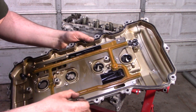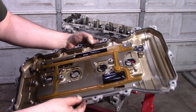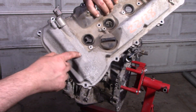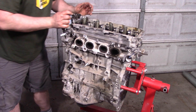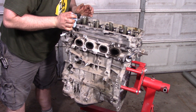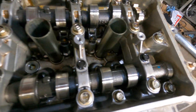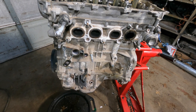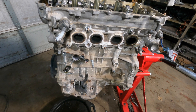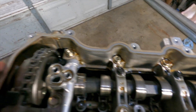They also changed the spray bar to plastic — that's normally metal. Not that it matters because this is single VVTi, but it's interesting. And now the moment of truth. This is supposed to be a low mile motor, and you know what? I think it is. Take a look — I'm not seeing any wild varnish. It definitely had regular oil changes, even if it is at low miles. The outside looks like it either got driven in the winter a fair bit or the owner lived on a dirt road or something. But this looks fantastic.